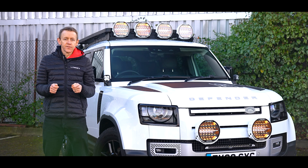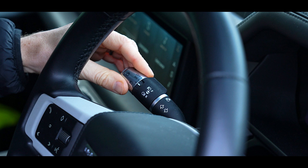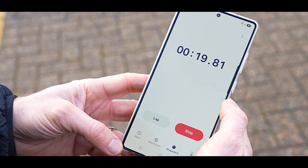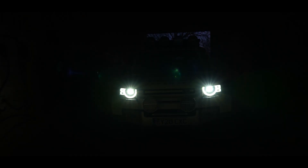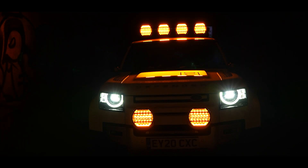To activate welcome mode number one, you need to turn the position light on for 20 seconds. It then needs to switch off and on rapidly 14 times, and once you do that you will see the position light blink at you to acknowledge it's now in mode one.